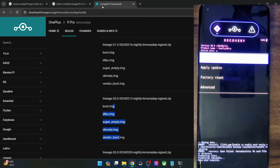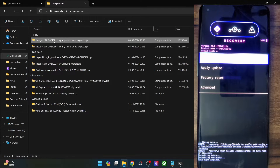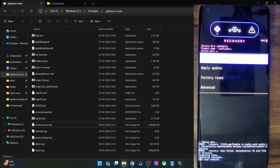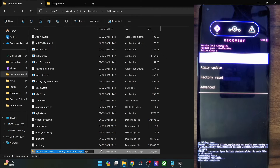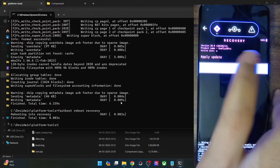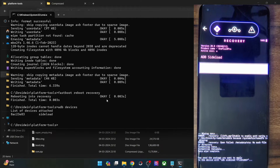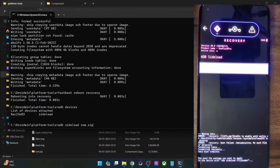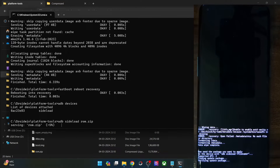I was initially on Android 14 and now I will flash Android 13, going from Lineage OS 21 to Lineage OS 20. Transfer the ROM file to the platform tools folder on your PC and rename it to something shorter — in my case, I'll rename it to ROM, so the full name becomes ROM.zip. Once done, go to Apply Update and select Apply from ADB. Your phone will now enter sideload mode. Type ADB devices to verify you see the sideload keyword, then type ADB sideload ROM.zip and hit Enter. The sideloading of Lineage OS 20 will now start and could take up to 6 to 8 minutes.